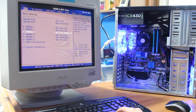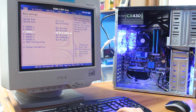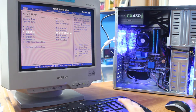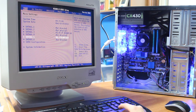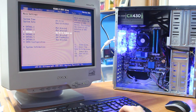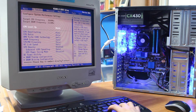You might want to change that. I probably will, because I'm OCD about this stuff, so I'll change the hard drive to the first port and keep the DVD drive on the 3rd. The hard drive right here is the M4 — solid state drive. You can tell by the names. It says 'DVD RAM' right here, so you know what drives are what. All of these are 6 gigabit SATA ports.